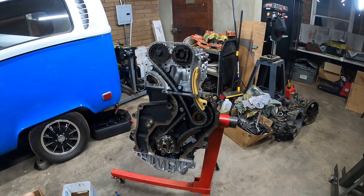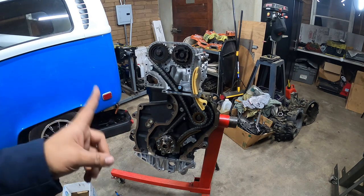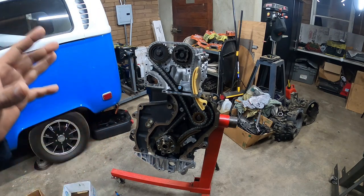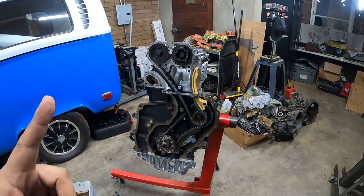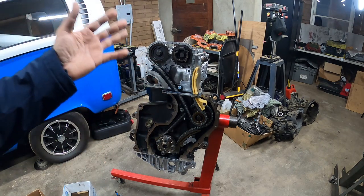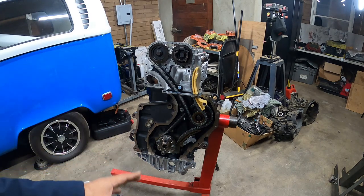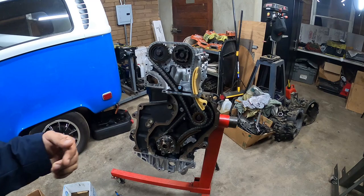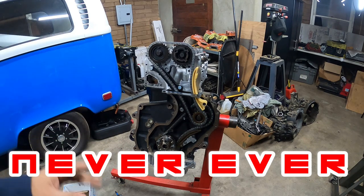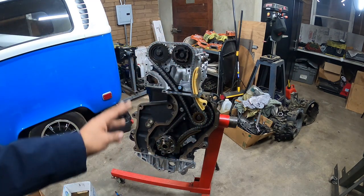To get started, remember that in the previous video on how to install all your timing gear and time it correctly, we didn't torque anything down to specifications. Now we're going to torque everything down to spec. The hardware I had previously wasn't new — I have brand new hardware here. We removed one bolt at a time and put everything back in with new hardware, because we don't want to be doing this job with used hardware. Never use old timing hardware. Always replace. Whenever you do a VR6 timing job, you need new chains, new guides, new tensioner — everything has to be replaced, including all the hardware.